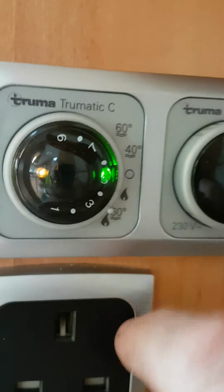That's hot and that's cold, so in between there, just open the tap up. And we would recommend even blowing into the tap at that stage to blow any excess water away from the head of the tap, because these taps are fairly expensive and they actually crack in here with the frost.